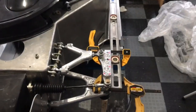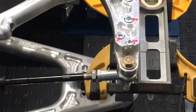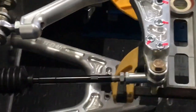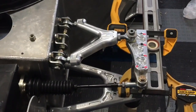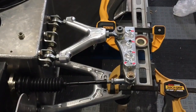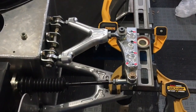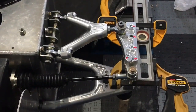The level has to get within a millimeter or two of the frame piece, but I was able to get it to zero toe-in by backing off the tie rod end a couple of turns. I'm glad I don't have to trim the steering rack. The next step is to fabricate rods that will hold the uprights exactly where they are now, so when I mount the wheels and put the car on the lift, the wheels don't droop and I can work on aligning the body.